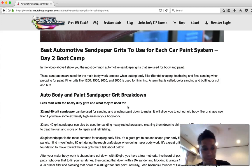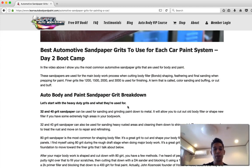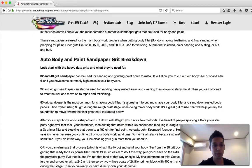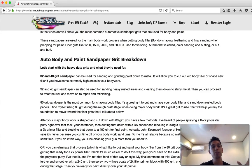So watch the video below. Now let's go over the auto body paint sandpaper grit breakdown quickly. You've got your 32 and 40 grit sandpapers, which are great for cutting down heavy body work. If you're doing a big body work area with body filler, a custom paint job, building out a fender or a wide body kit, or covering and patching a lot of rust spots and holes, you want to use 32 to 40 grit to initially cut down your mound.